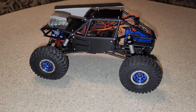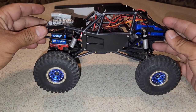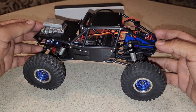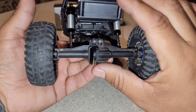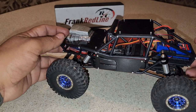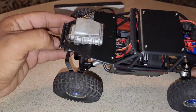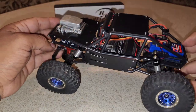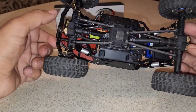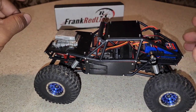What is up guys, back with another video. Today I'll be showing you how I converted my TRX4M to this Tarantula from the Injora chassis. I'm running Injora shocks with springs removed for a full droop setup, a waterproof 7kg servo, and an Injora 55-turn red can motor. I've also got some brass here, and we're gonna take it out and see how it does.